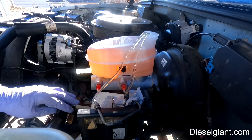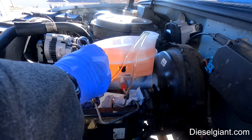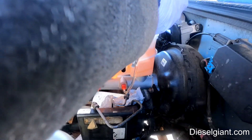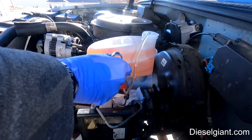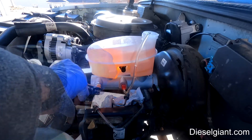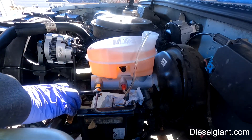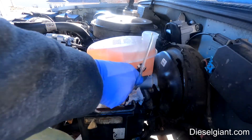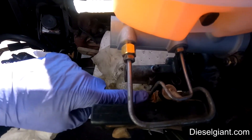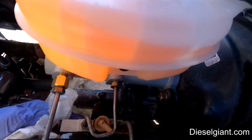Here's where it gets a little messy. I'll do the adapter side first — I'll remove the bleeder tube and quickly connect the brake line, since brake fluid is already leaking out so we have to work rather quickly. I've gotten all the lines on and tightened up, and I went ahead and sprayed brake parts cleaner on everything to make sure it's nice and dry. The next step is to bleed each wheel.